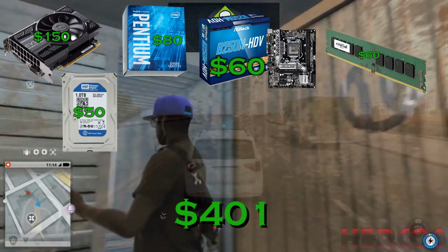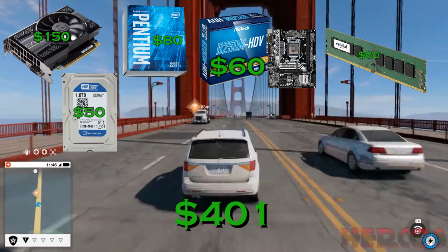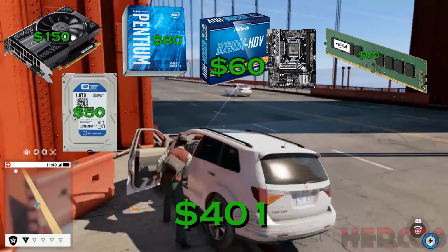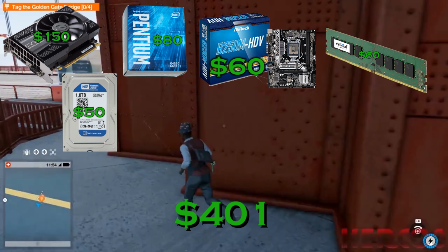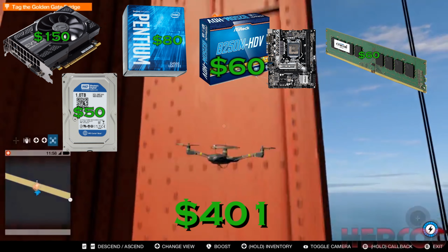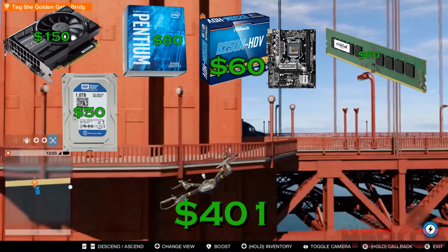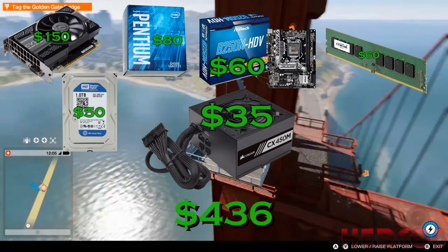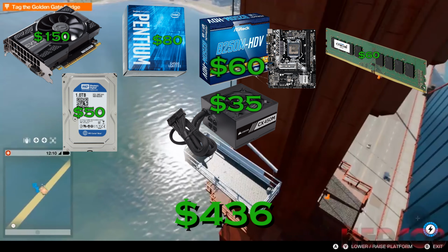Now we have $95 for a case and power supply. Getting a power supply is always hard for people. Everyone thinks that the higher the wattage, the better the quality. And while this is true, it's not really necessary. With this build, a nice 450 watt unit should be just fine. In fact, a CX450M is only $35 after rebate.